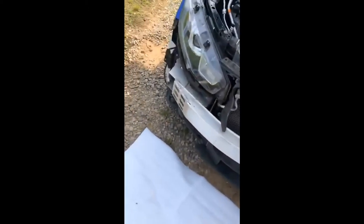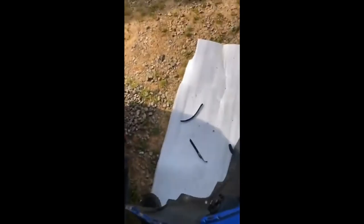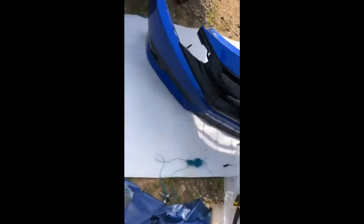We're pretty much ready to get the bumper back on. First, remember to hook your fog lights back up before you do anything — as soon as you get it on there. Clean out your trash and make sure you have everything handy. Remember where everything goes: plastic clips and a couple of screws. You can put these black trim pieces on last because they won't go tight to the grill right away.